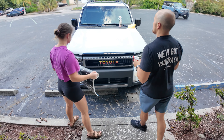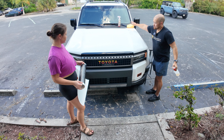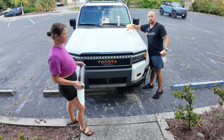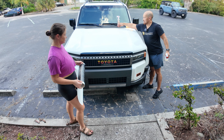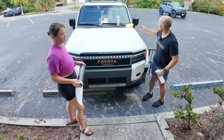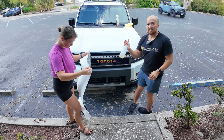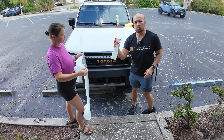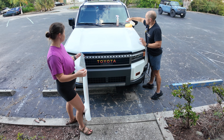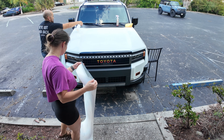The best thing to do before this install is to get your entire vehicle cleaned, but if you haven't done that, at least spray down as much as you can with your speed wipe and take your microfiber to it. Pop your hood up and be sure to clean that trail edge because a little of the hood might wrap over. In my install it will wrap over because I don't want any gap on the back side between the hood and the plastic molding. Take some of your Sticker Fab application fluid or your soapy water mix that we talk about on our website and spray this entire area down — be pretty liberal with it. You want the hood overlay to initially be able to slide around easily; it'll help with alignment.